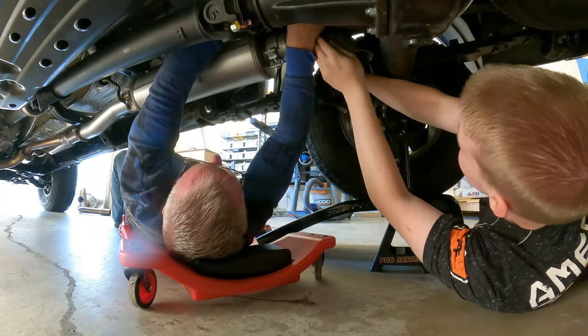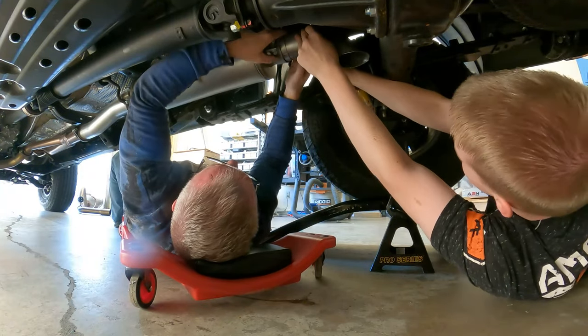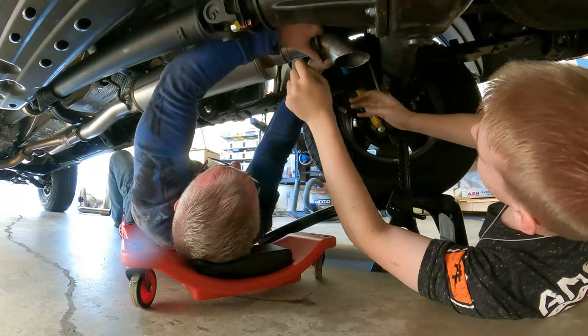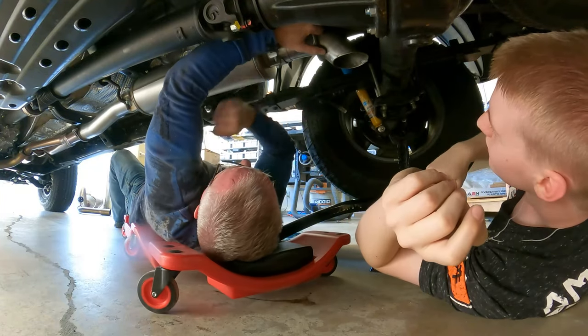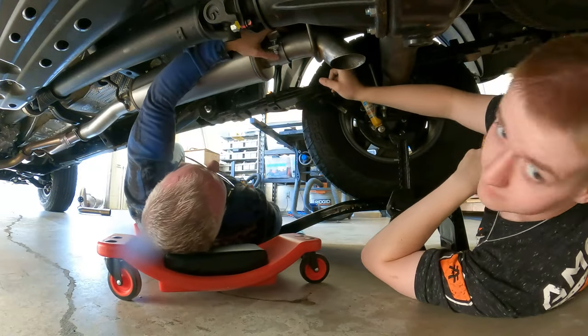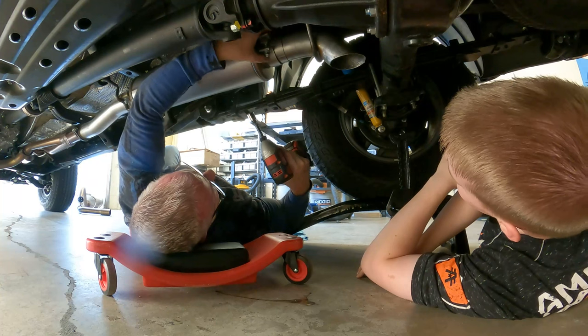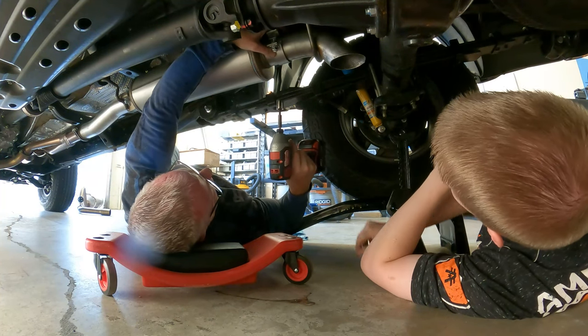So it's nice and strong on the... I'm just pushing it forward. Yeah, get that all the way in. As much as it'll go. You want the persuader? Nope, that's on. Then we'll tighten this one up. Make sure you put your bracket right over the cut flange, because that's what cinches everything together.